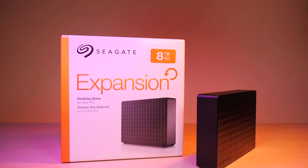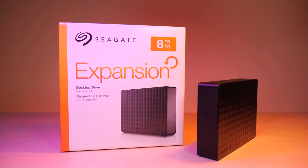We also have that Seagate external 8TB backup drive we reviewed earlier this quarter, link up here if you want to check that review. It's always off, however, it is plugged into battery backup because having a hard drive lose power when doing data transfer is a sure way to get data corruption. Whatever your setup, you should choose the essentials only. Your PC, your main screen so you can see what you're doing, and any essential connected drive so that you can save your work or finish your stream or render before the backup is exhausted.